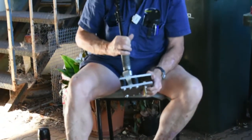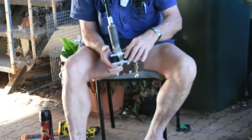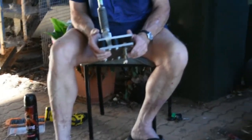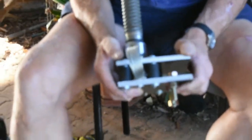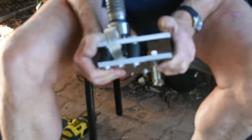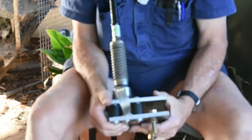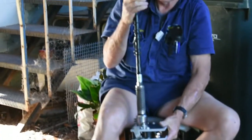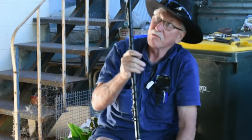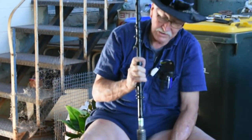Now as you can see here — and Karen might focus down on here for a minute, come in close — you will see that as the vehicle moves and as the wind blows, there's movement in those rubbers there. That's the idea of it. The idea is that all the vibration that's happening down here does not get transferred up to this stick, so it won't be shaking the hell out of it. Thus, that will absorb it and mitigate the effects of it.